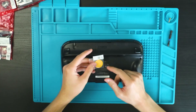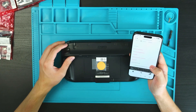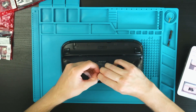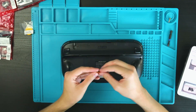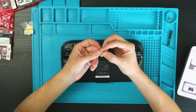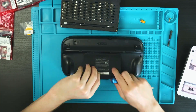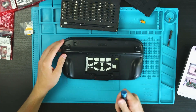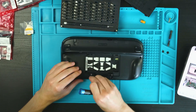This Giltessa board right here will help us get USB-C on the Wii U gamepad. I'm going to scan this QR code — that's our guide. You have to scroll through the listing to find the written tutorial. It's very simple, it should literally just be two pads. Getting out the iFixit toolkit, we can use a Phillips 0 bit to remove the battery, and then we've got 10 screws to remove.